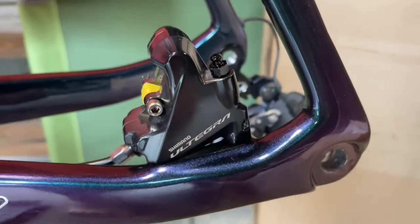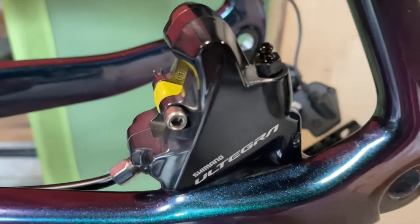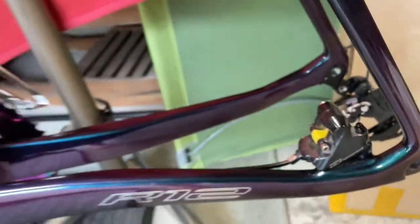Brake is now reattached. The port is closed. I'll put the bung on in a little bit, but I'm just going to bleed the lever back and forth just to see if we've got any air in. Back brake is always the hardest one because it's got to travel the furthest. So we'll just do that, carry on doing that — you can see the principle.